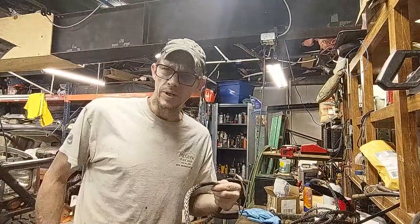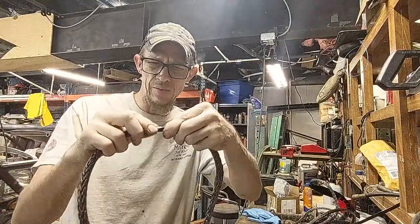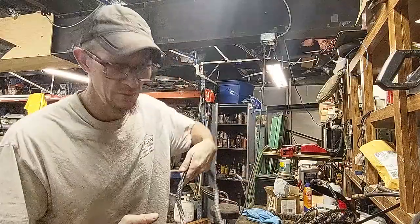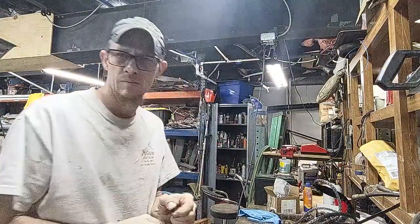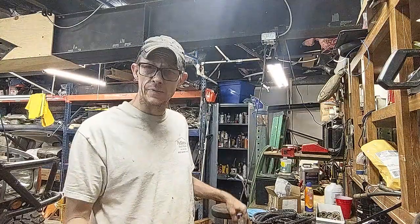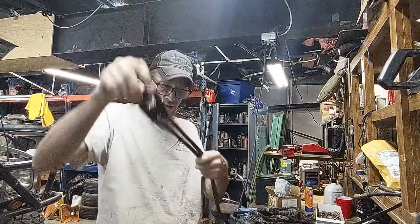This stuff can be kind of a pain to trim. What I'm going to do here is put a little tape on here - if you've ever done stainless wire or stainless hose work or whatever, we'll tape it and I'm just going to hit it with a zip wheel real quick. Per the direction of the Factor 55 stuff, you want about a 30-inch bury on this 3/8 rope.